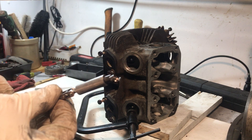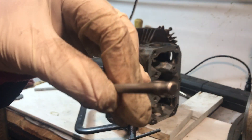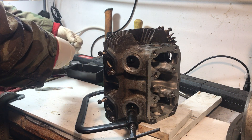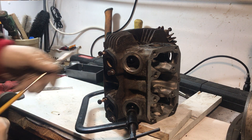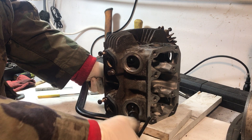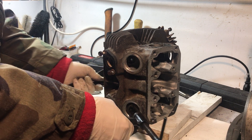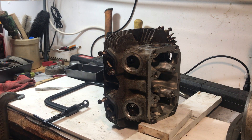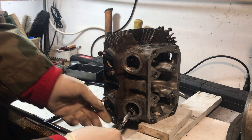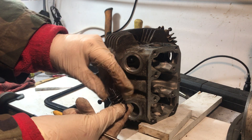You can pull about two at a time in this case. That's what those keepers look like — they neck around the top of the valve. Here's the valve: the keepers sit around a little divot in the top of the valve and hold everything in place. Then you release your tension carefully, holding it steady so the spring top doesn't bounce. You take the retainer plate off, and then the springs themselves — there's an inner spring and an outer spring that sit down on top of the valve head.